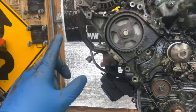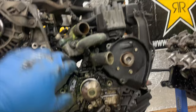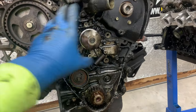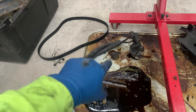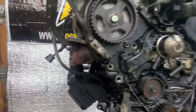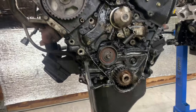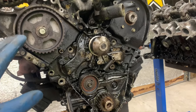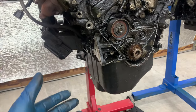When this cam snapped, not only did this bank probably collide, but because the timing was all off, I bet it hit all the way around. I am able to turn this motor over by hand, which means probably pretty low compression - the spark plugs are still in. I took off the coil wires and started pulling down the front accessory. There are a lot of different bolts on here. I pulled off the oil filter housing and the lines for the cooler. I'm going to keep working front-to-back, keeping good track of my bolts, working top-down.